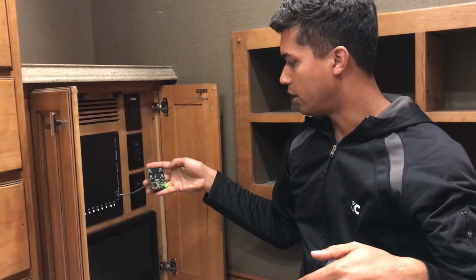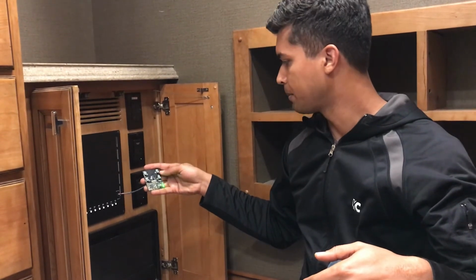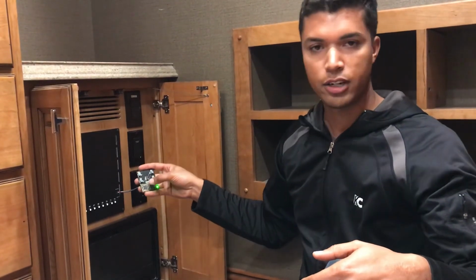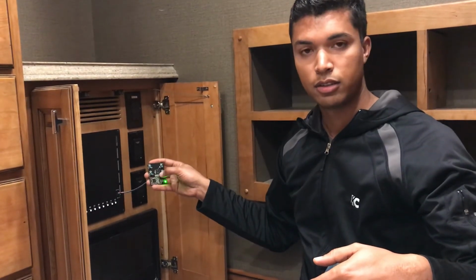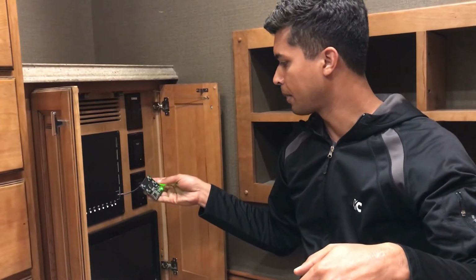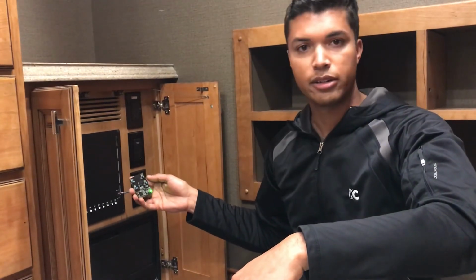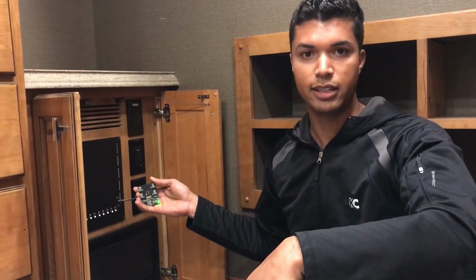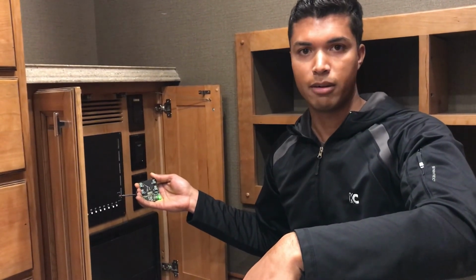Then you want to observe on the programmer switch panel that this LED is solid green like this. Now on this panel you've got four different buttons here, and if you follow the instructions included within the packet, just follow those instructions on which button to press to push the proper config onto the Spyder network. After you've pressed the button and updated the Spyder system, then you can go and observe on your Spyder LCD screen the tank readings being sent over the network from the sea level system.